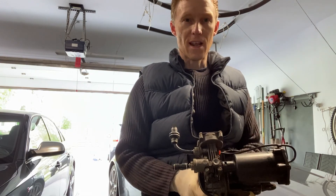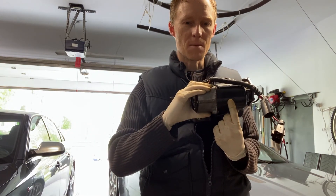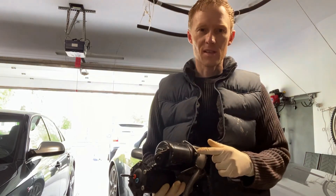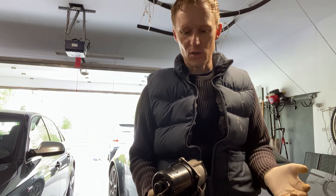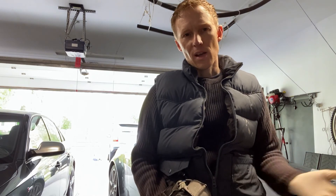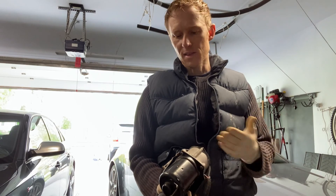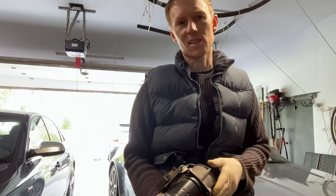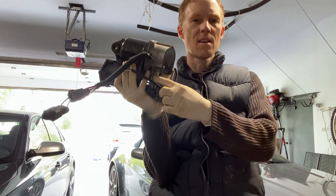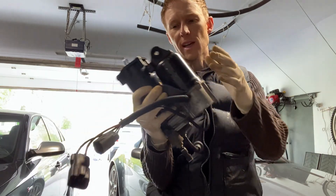The issue that I think happened with this pump was not so much the seals, but the seals inside the pump can go bad. Following the video I was able to replace all the seals — it's not that big of a deal. The manufacturer's video is good but there are a few problems: they don't show you how to replace all of the seals. If you follow the video verbatim you find leftover seals. If you look around you'll find where they go — there's a seal in here they never showed how to replace. I replaced the piston seals, the glide ring, and put sealant around the end cap, which was stuck on with silicone sealant that wasn't included in the kit.